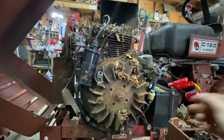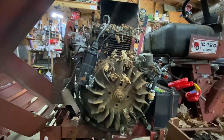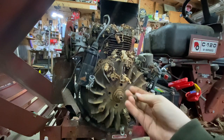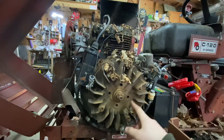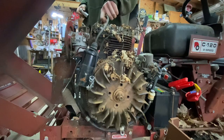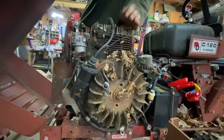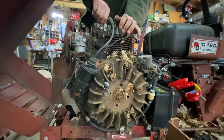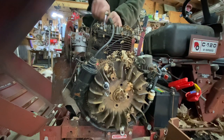It doesn't look great in here but it's not horrible. Of course Kohler has to have a screen you need to remove to get the cover off, and someone already did the service of stripping out all the Phillips heads - fantastic. I'll blow all this stuff out. The spark plug actually looks fairly new - I'll put that back in. Once I get this all cleaned out and clean the carburetor, this thing should fire up and run.